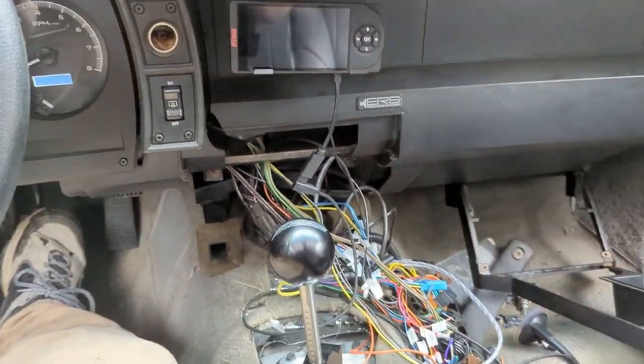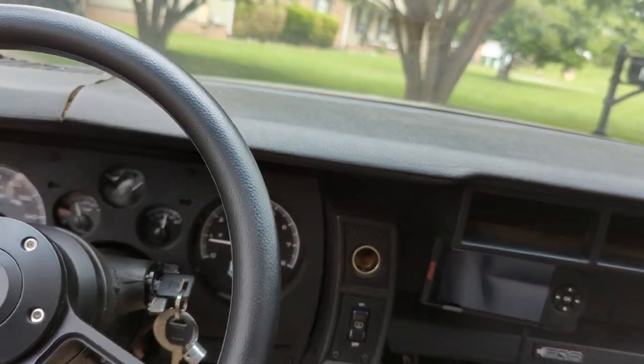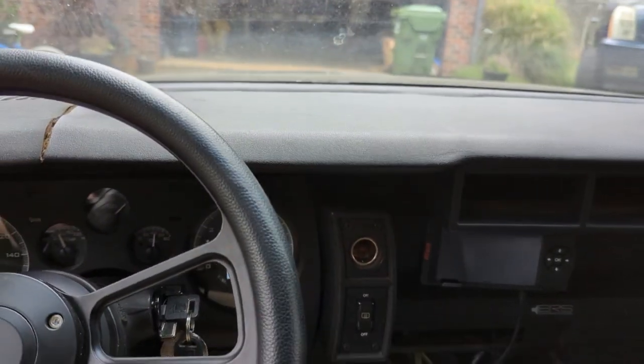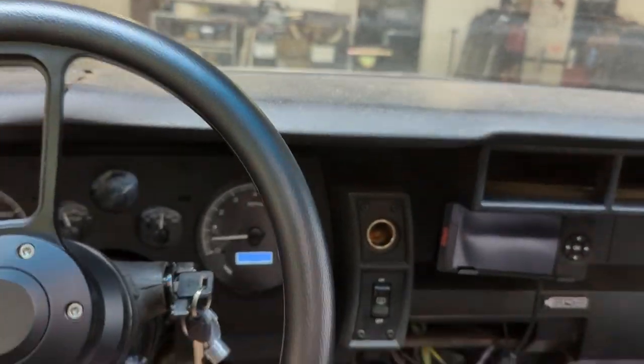Well, I got her outside. Evidently we basically have no clutch. I figured out how to get it back in gear — we had a clutch, then we bled the clutch and now there's no clutch. I'm going to start it in gear and see how that goes. She's in gear, clutch is all the way in, but the car is already rolling forward — it's in gear, gaining speed. So we'll have to bleed this clutch again. That'll have to be later.